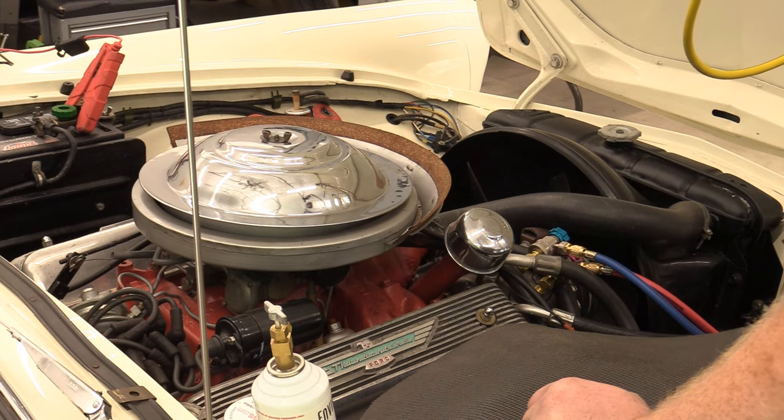So we tightened that one fitting. We lost only about three inches of vacuum in an hour, which with the Harbor Freight gauges and adapter fittings we're using, that's acceptable - much better than before. It is not hissing now. It was an inch a minute before, but now it's holding steady and we don't smell any refrigerant anywhere inside. We still have a little residual, but that's coming off of what it was doing since it threw that stuff into the squirrel cages.